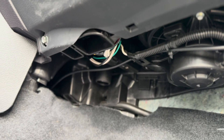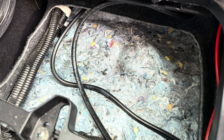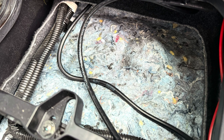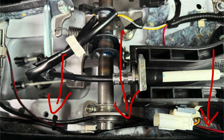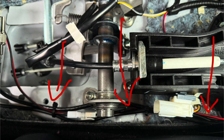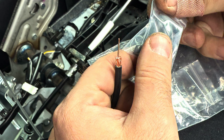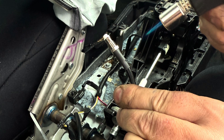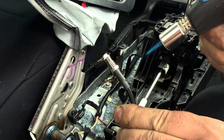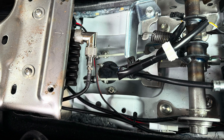You can pull your wires through and tuck them up neatly as best you can — we did ours next to the blower motor. Pulled them through the cup holder area underneath and stuffed everything on the passenger side of the center console, since there's a handbrake on the other side. Once we had our length, we shortened up the wire — cut about six or seven feet off — hopefully improving functionality. Then threw a new connector on; it requires some special tools but it's not too hard, and put a little elbow in there for extra room.